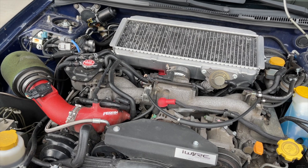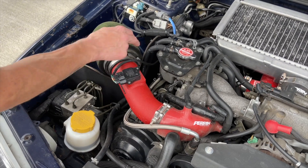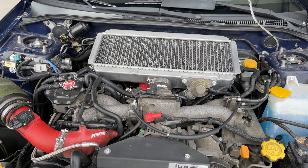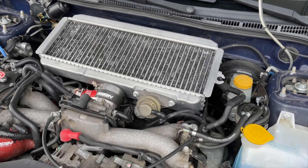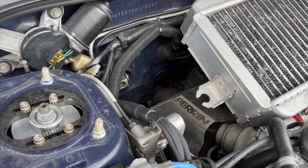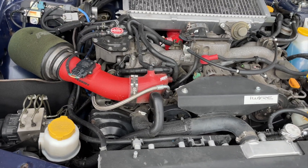This car has a ton of recycled parts from my 2005 STI — we're doing a separate build on that car so we didn't need a lot of this stuff. We're running a Perrin 3-inch turbo inlet and a Perrin short ram intake. We built a custom little box right here to keep the heat from the up-pipe away. The intercooler we're running is a 2008 STI unit — I believe that is the biggest top mount intercooler that Subaru made for any of the years, so it's already a decent upgrade. We also have a Perrin heat shield back here, and a braided line which is your high-pressure line for the power steering.